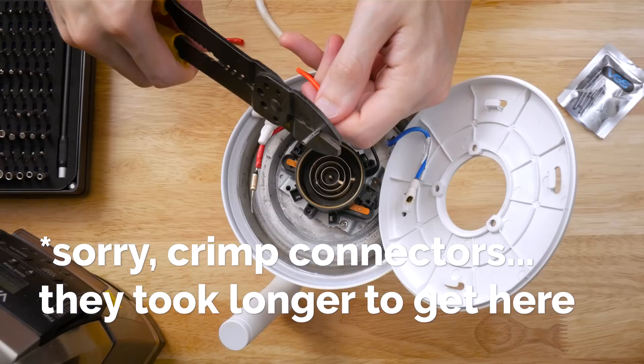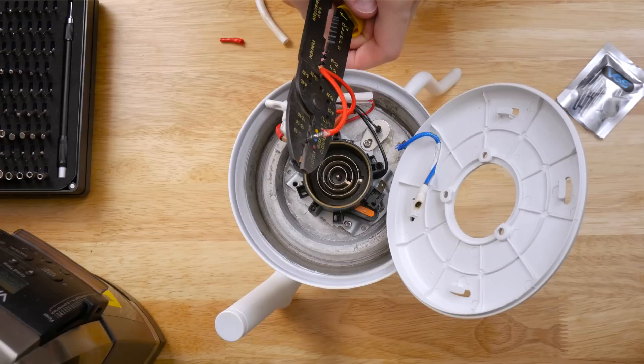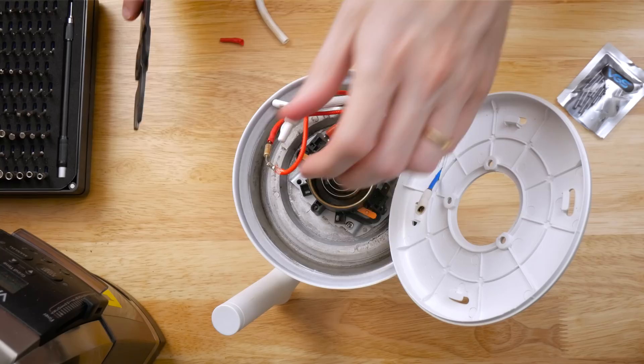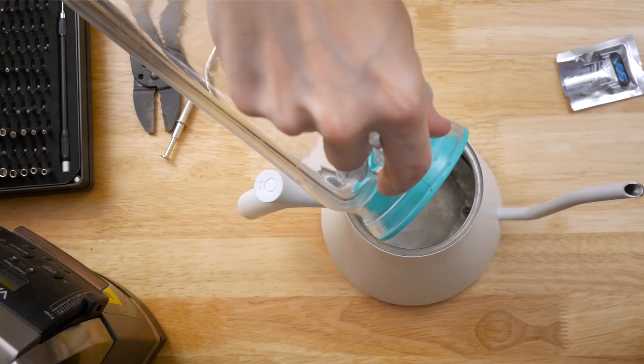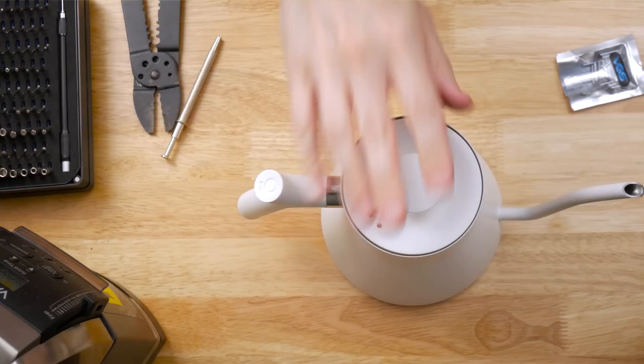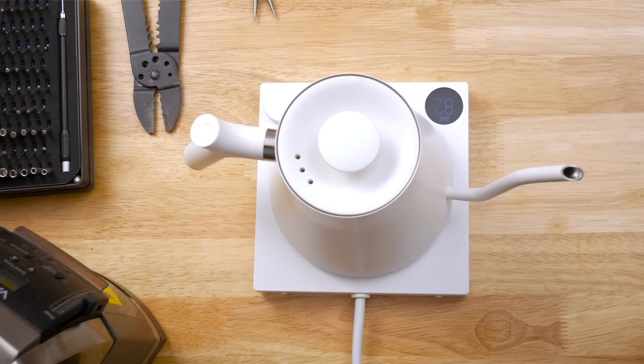So let's do it properly. Crimping is pretty straightforward, but it is a little fiddly trying to get the wire into the crimp connector, so just be patient and take your time. Check the connections to make sure they are secure, then go ahead and slide the fiberglass sheath back over. Put the screws back in and everything closed up again. All we need to do now is put some water in and see if it heats up. At this point, I literally held my breath for about 10 seconds until I heard the click, and then the kettle started to heat up.